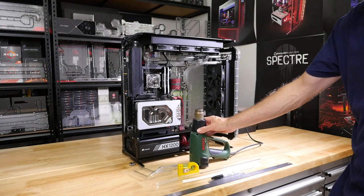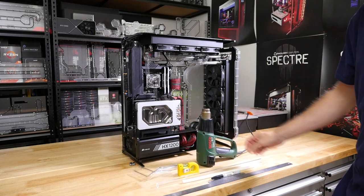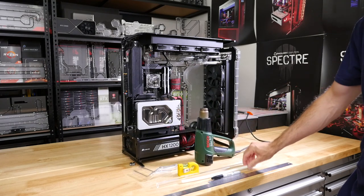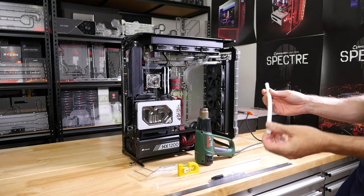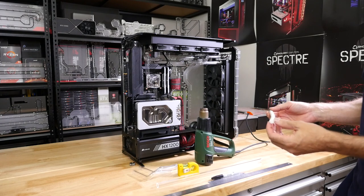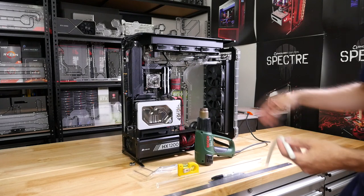So what you're going to need is a heat gun. It doesn't really matter what brand, but it needs to go up to about 400 degrees. I use maximum fan and about 350 degrees. You will need, depending on your tube size, a silicone tube insert. I'm using the one from the EK tube bending kit. I'm always using 16mm tube — that's my personal preference, mainly for aesthetics, but also for performance and flow. Using bigger tube is better.